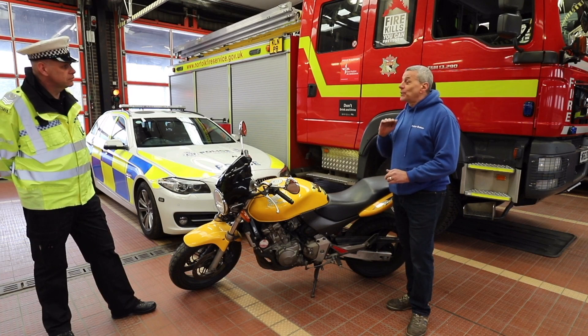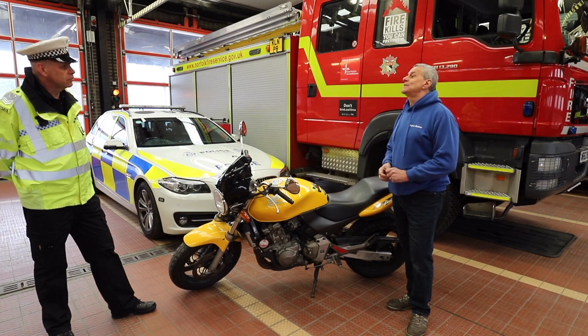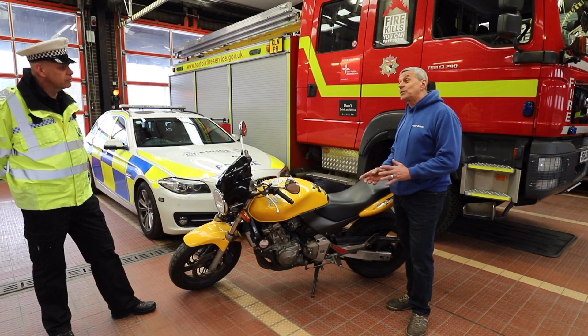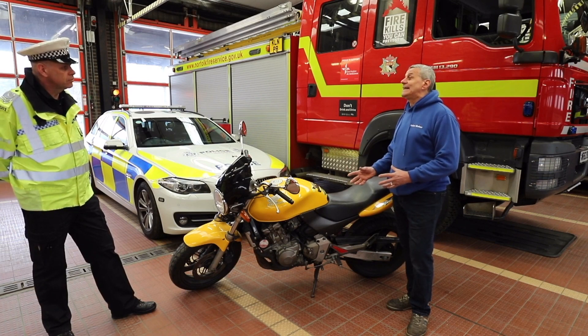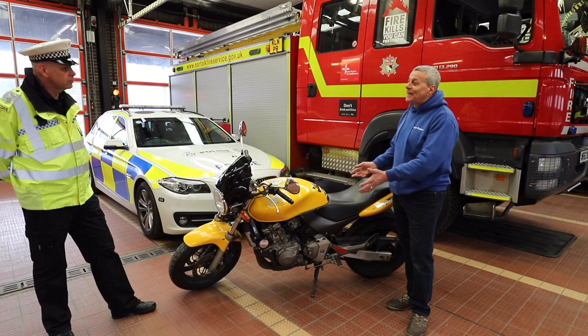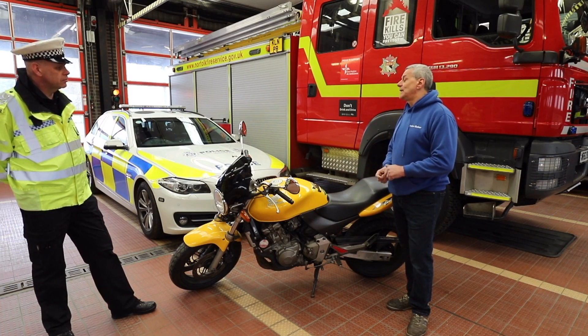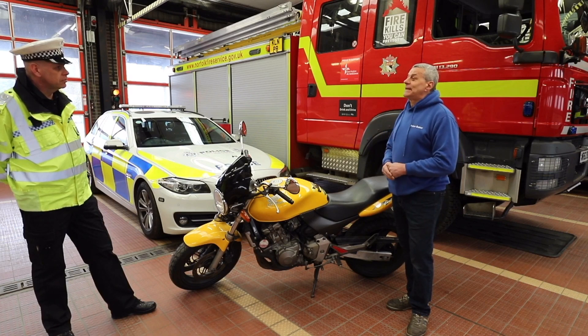You want to know that you've got a full level of oil. There'll be a dipstick or a window so you've got the right amount of oil in your engine, but equally have you got any leaks? So check around the engine, left and right, underneath — have you got any leaks at all?